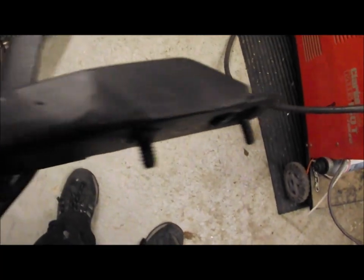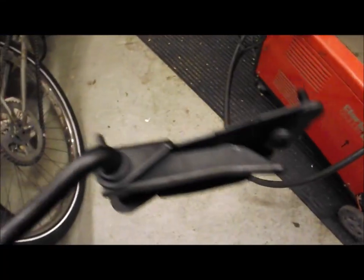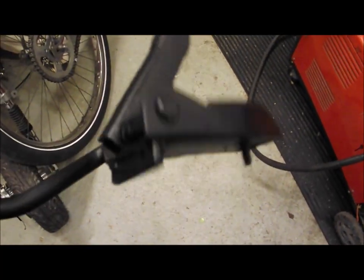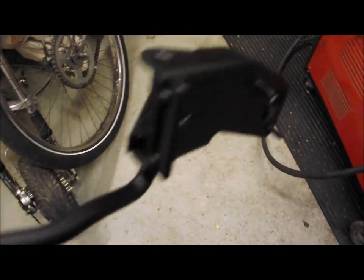Okay, so the finished article there, with the strengthening bracket, strengthening rib put in place. Got a little tab at the bottom there, just to hold it off the bulkhead, which increases the travel of the pedal, just so I can get full wide open throttle. There we go, finished, giving it a coat of matte black, but since it's only 2 degrees in here, just run over it with a hot air gun just to try and flash it off. I'm going to put the heater on now and just see if I can get it finished off and probably fit it tomorrow. Okay, thanks.